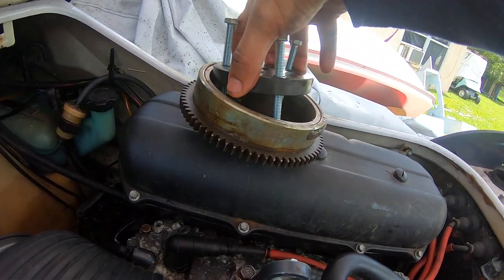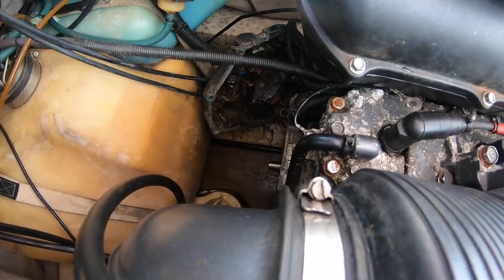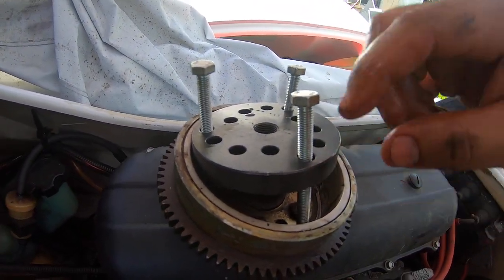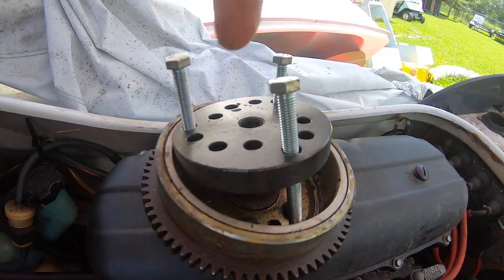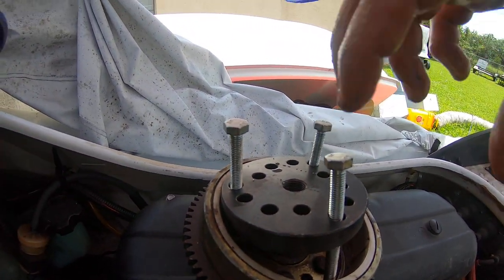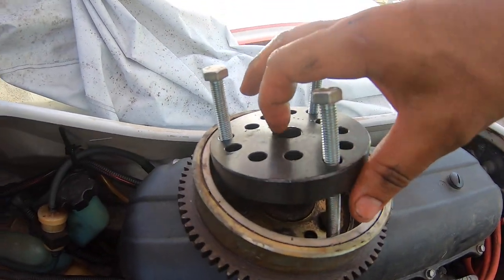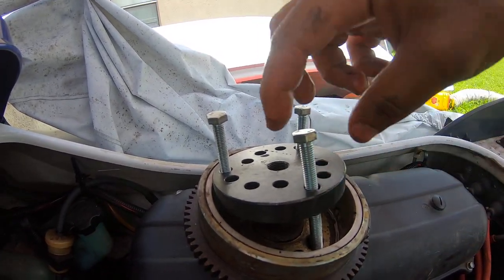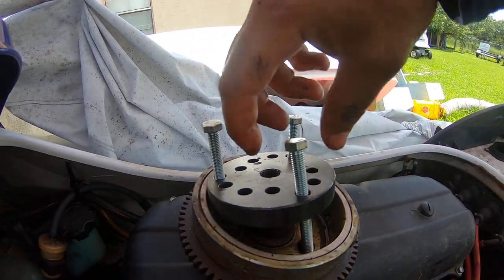So you screw them in to the front. It's a lot of patience — it took me a really long time to get the screws in. I suggest maybe using just a stud type and then use a nut on one end, so you can just put it in the hole while the flywheel is in there. That way you don't have to mess with it, because this is all magnetic. If I ever had to do this again, I would get just the studs, put them in the side of the flywheel, then put the puller on and put the nuts on there to hold it.